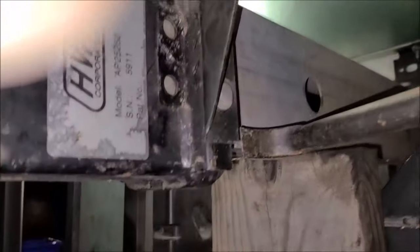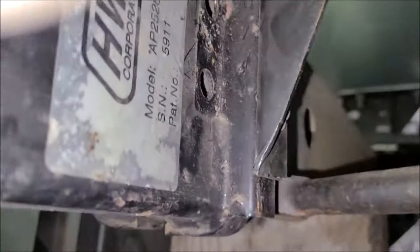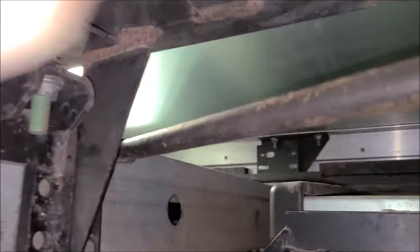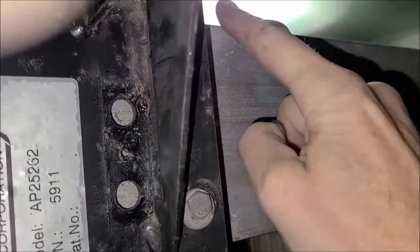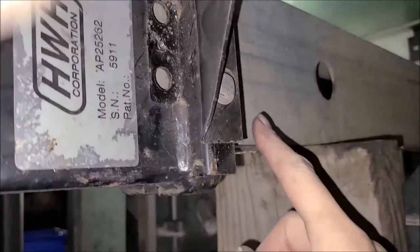That's helping. Another thing I did, the last part, we're using this great pry bar here, putting it like this and applying direct pressure to it, and getting up here and doing that again. Be careful when you push it over. You want to get up here at the top edge and the bottom edge. You don't want to be pushing this area here. You want to keep that smooth, and that's the thin part too. You could possibly bend it, so you want to be careful with that. So now we got that.